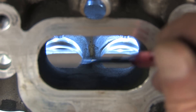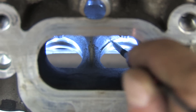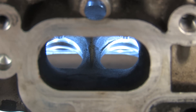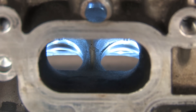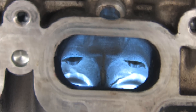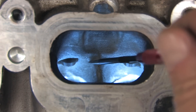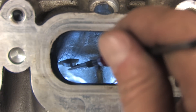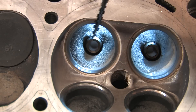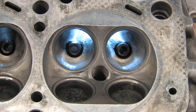Let's take another look at the stock intake port. You'll see the divider is a big fat round glob of rough cast. If you look closely, you'll see there are several distinct angles molded into its base — the intent was to deflect and aim air towards the center of the valve and away from the seat. You would want to maintain these angles in the knife edge you create while porting it — don't eliminate them or blend them together. You need them and the turbulence they create. Notice the injectors fire right at them. You're going to enlarge the bowls and runners slightly in this process, so you'll need to contour the areas of the roof past the divider and adjacent to the valve guides right into the bowls. That's what I mean by raise the roof.